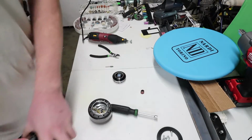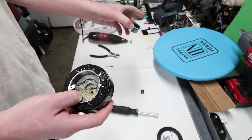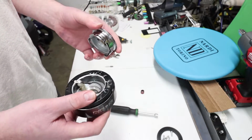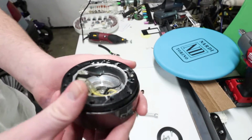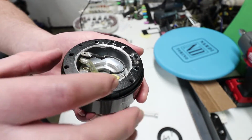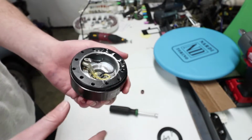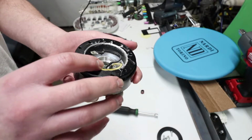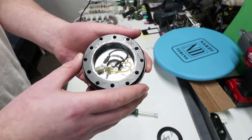So the next step that you're going to want to do, now just a reminder, this is just if you have a Nardi steering wheel. I don't know of any other steering wheels. I've only owned Nardis, so I'm pretty sure it's just a Nardi problem. But if you run into any issues when you're installing a wheel that has a button, maybe think about doing something like that. Really what you want to do is make it so this beveled edge right here allows the clip to slip in, because the clips will compress and fit in there fine, but there's just no way that you can compress all 3 points on the clip while you're putting this wheel together. It's just not possible. So basically what you're doing is making a little smooth transition for the clips to slide into, and then they'll slide down into the flat surface, and everything will be okay after that.